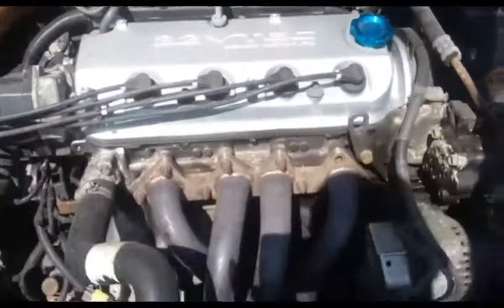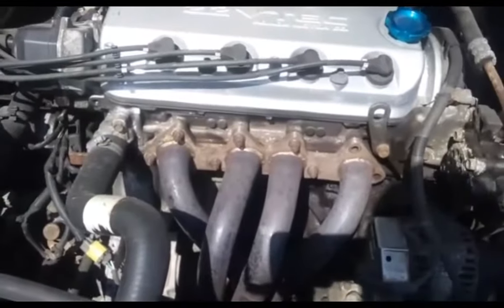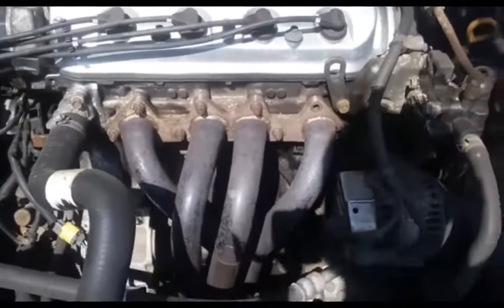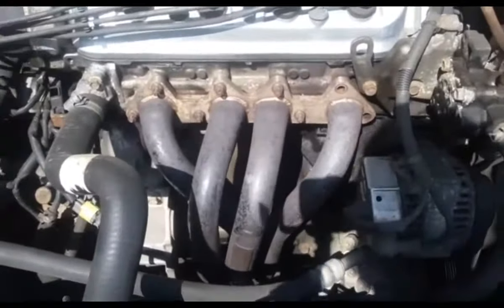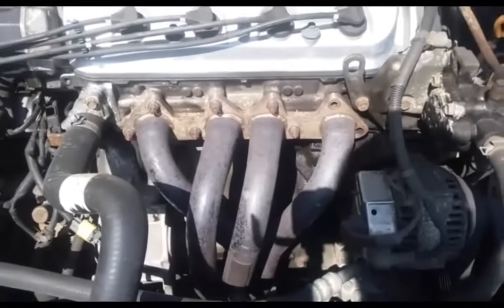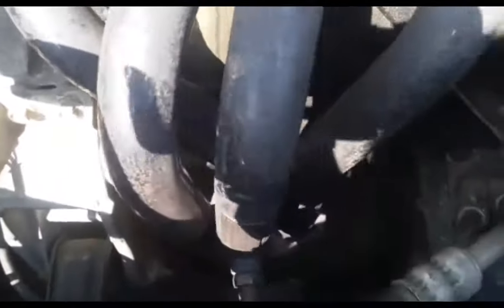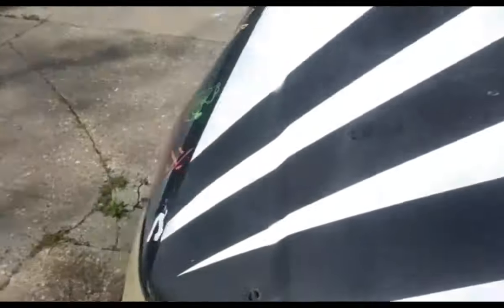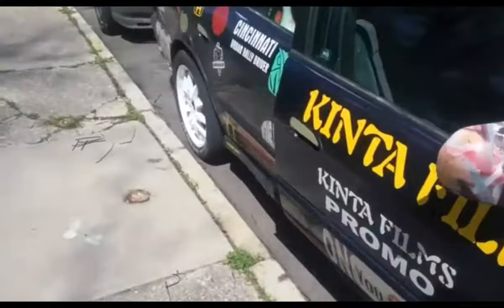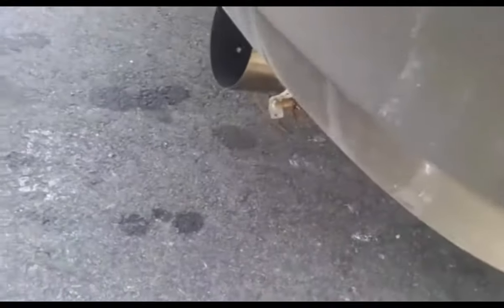The engine has no more than a cold intake, a strut bar, and I did run a full exhaust. The strange thing about the exhaust: when I found headers that fit, most people put headers on without the O2 sensor, but without it this car runs like crap. I went back to the junkyard and figured out that a Prelude manifold fits on here. The Prelude O2 sensor is on the front — not the side — and I used a Prelude O2 sensor. It works very well. The exhaust I found recently and it's rigged up in there, but that's how things go.